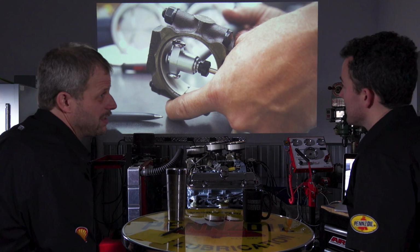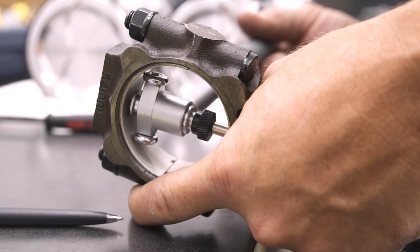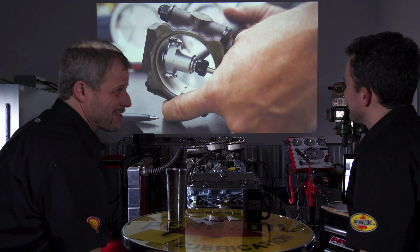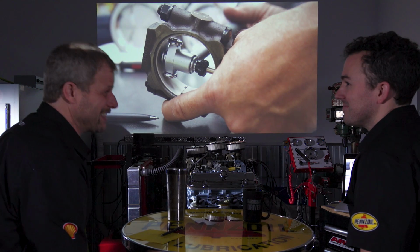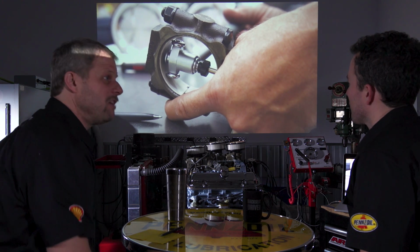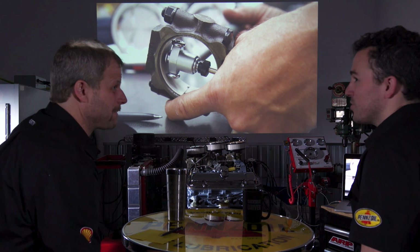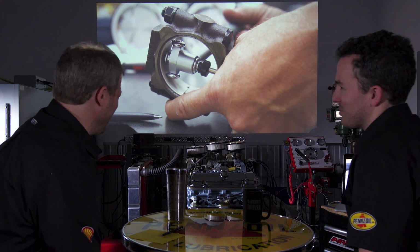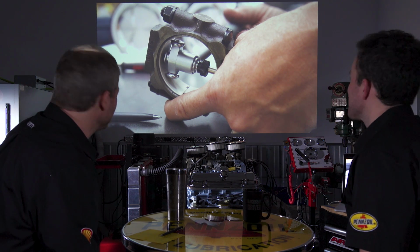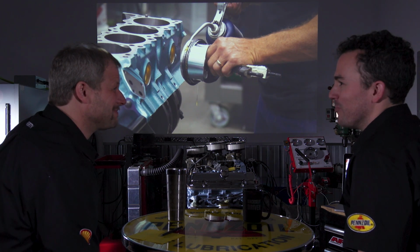Which is where we had 30 over bearings, but we were using the 40 over crank or something along those lines, which was why we measured it here. Because if we had just thrown it together, it would have clattered like the daylights and would have been eventful when we started it up, we'll put it that way. We got a little overzealous with, oh, we're going to save 2 cranks, and then confused ourselves by not realizing which one we were using. So it was a quick call to Thurlby, and we had another set of bearings the next day. Yeah, that day ended early. We were like, all right, well, guess we're going home. They'll be here in the morning.